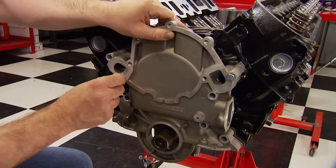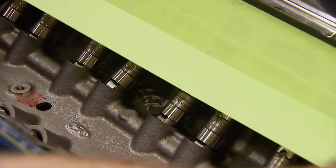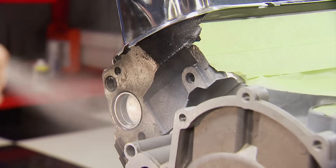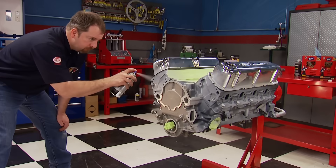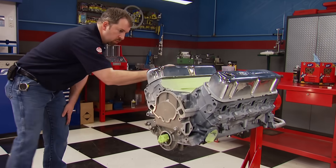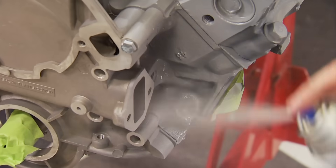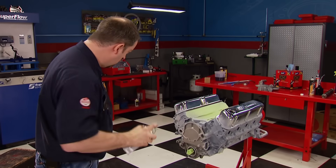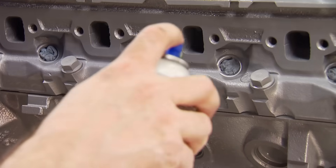Back in the shop, we're using tins to cover the engine internals so we can paint the block and heads. First, engine enamel primer with ceramic goes on — it's oil and gas resistant, withstands temps up to 500 degrees. Then it gets Duplicolor engine enamel with ceramic in cast coat aluminum to keep a consistent silver look with the tins. After it's dry, we remove the valve covers and tape to continue the build.